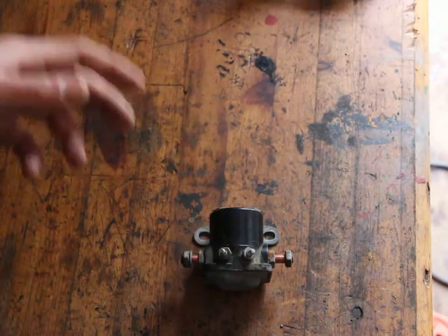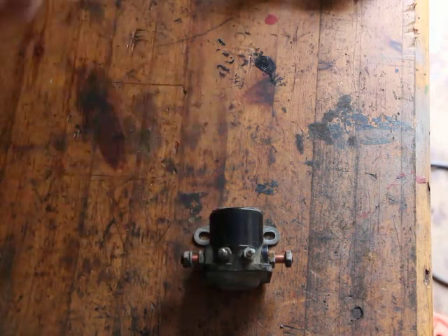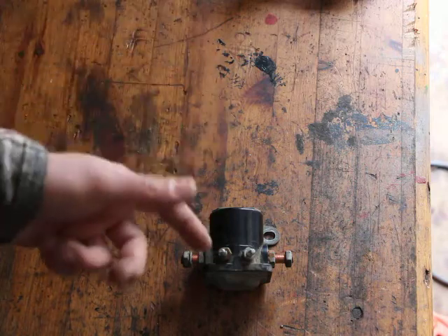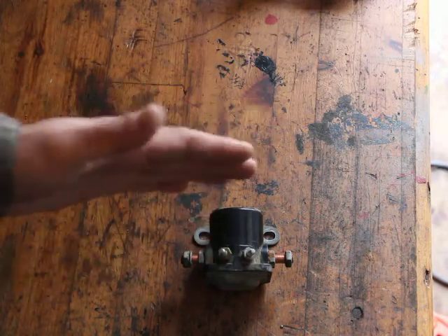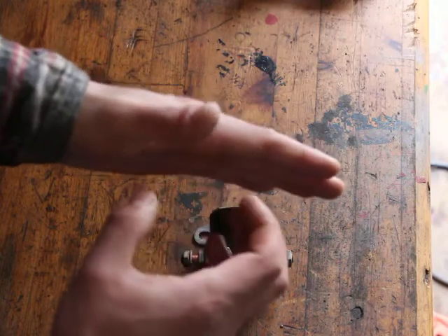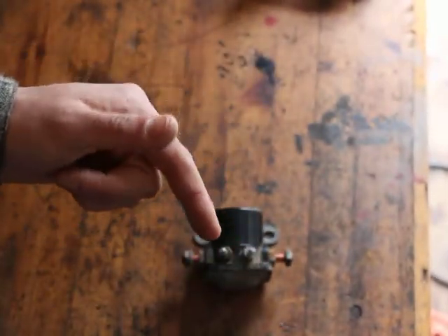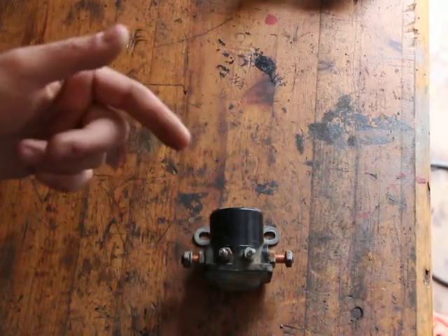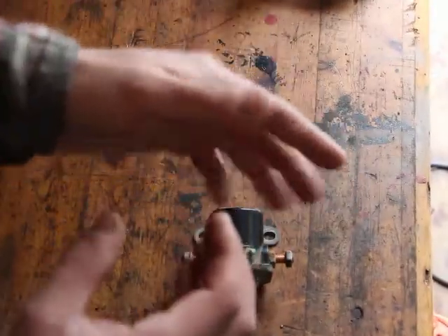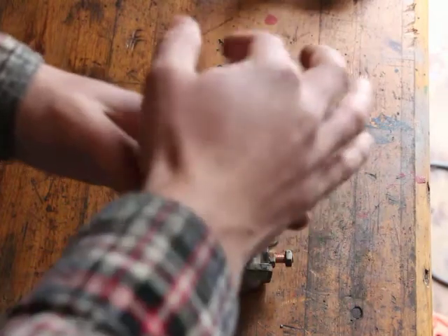There are two types of switches: a normal-on and a normal-off switch. In here you don't want the starter to be on all the time - you want it off most of the time, only turning on for a second just when the car starts. So the normal position is off, and a spring keeps the top bar apart. When you turn it on the magnet attracts and closes it. A normal-on switch is the opposite - it's normally on and only turns off when you press it, using an electromagnet on the other side to separate the contacts.